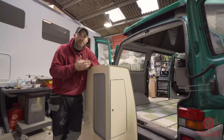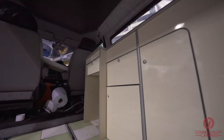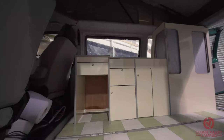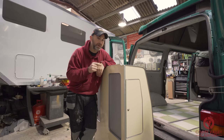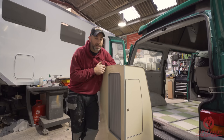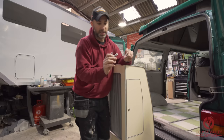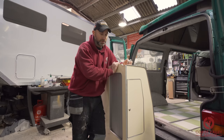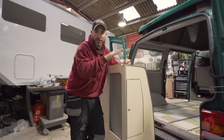There we have it. We've profiled the edges and reinstated the T-trim around them — really, really happy with the fit. We had to profile the interior because the floor is a lot thicker than you would have in a normal van. I'm not going to show you exactly how we screwed it into this van because you've probably got a different van where the fixing points will be different. What Evo Design give you is a bunch of fixings, and as long as you place them right on the floor, in the side ply on the wall, or in the metal areas of the vehicle walls, you will have a sturdy interior. Just make sure you get clearance on your bed, your fridge door, all your doors, and if you've got a pop-top, make sure everything on your pop-top fits nicely against the interior.